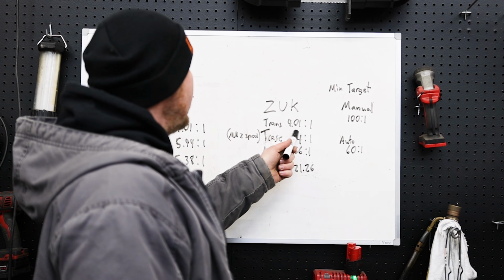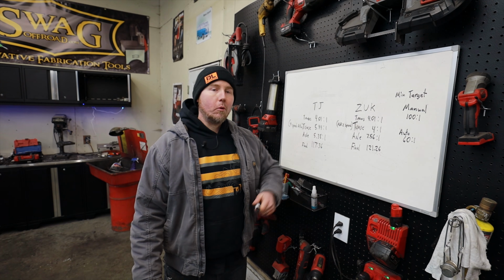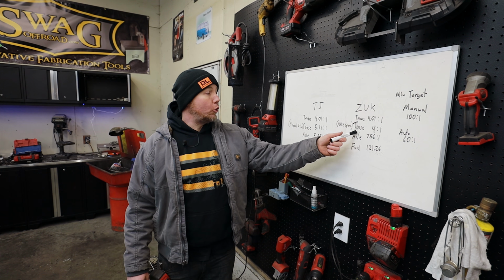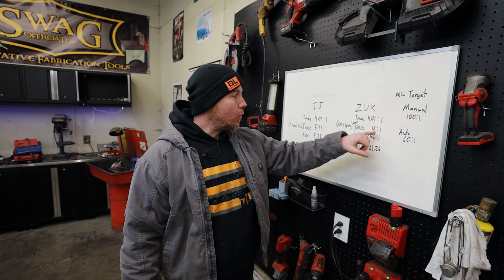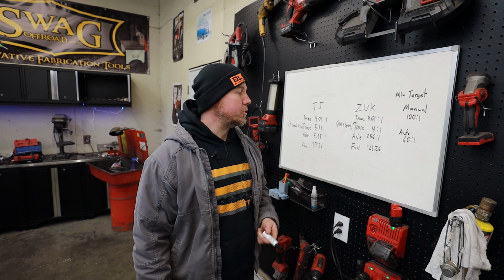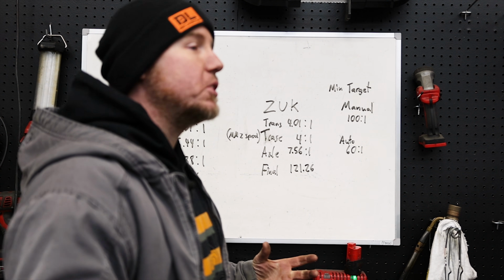With the Zook, we have the same transmission, basically 4-to-1. We have the Midnight Metalworks 2-speed transfer case that's a 4-to-1. So as you can see, it's not geared down quite as low as the Atlas, but you could do a doubler on the Midnight Metalworks if you needed it. But to me, the big selling point of the Midnight Metalworks is that it's a smaller, lighter case, and with 4-to-1 gears, you get a lot of flexibility, especially when you're going with axles that are geared as low as these. These are a 7.56 to 1 gear ratio because it reduces on the hubs.